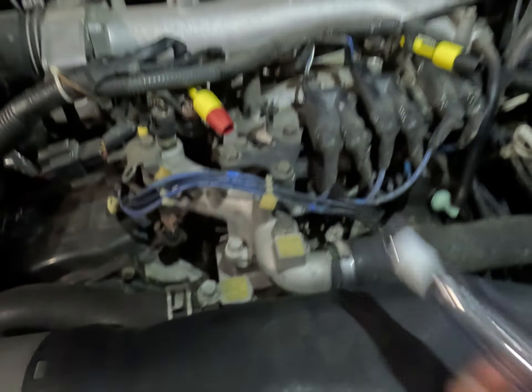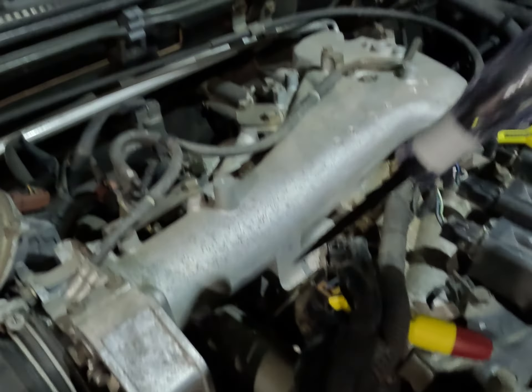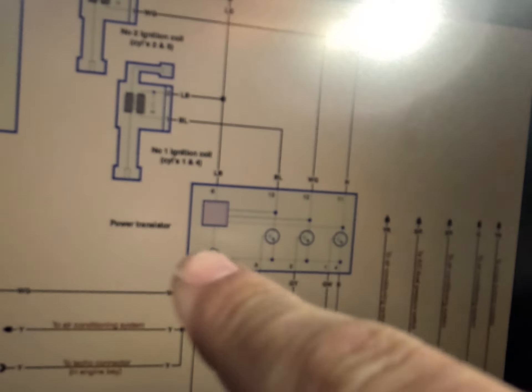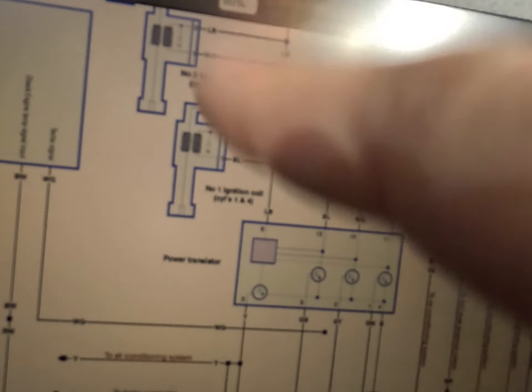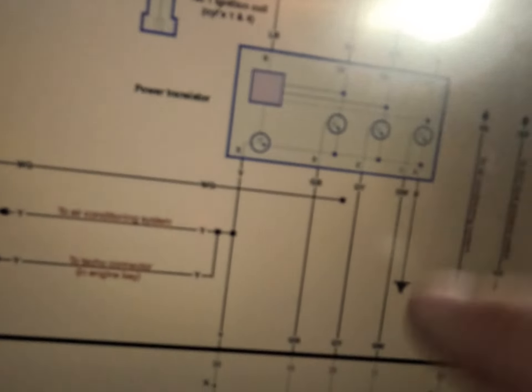So as you can see that's flickering on and off — the ECU has good control of the transistor in the coil module. However, the transistor in the coil module does not have control of this ignition coil. So this vehicle is going to require a new ignition coil module — this unit up the back. Everything else in this unit is fine, the two other coils are operating fine, the wiring integrity is good, and the coil itself is good. It just needs a new coil module.